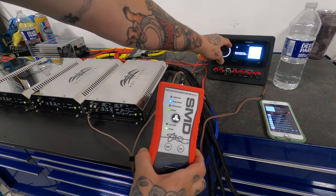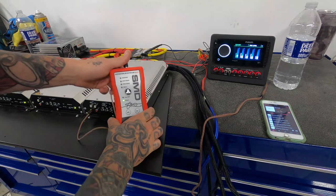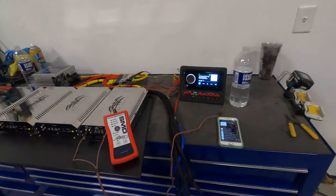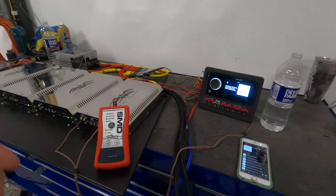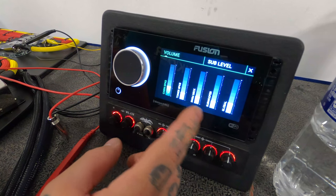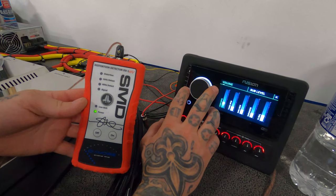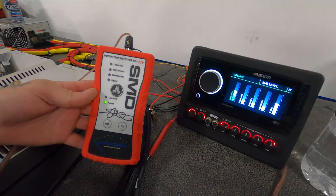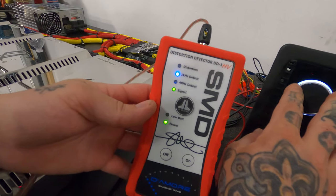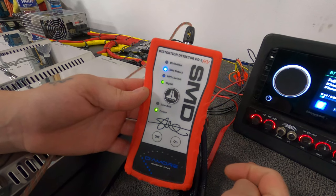This is going to be our input from the head unit. We're going to go to our cabin speaker volume. I want to show you the zone control on the radio — if we go in here, we have four-zone control and a global. So we're going to go one zone at a time setting gains. As we go up measuring zone one — which is our cabin speakers — we're going to see we get signal measuring 1K. At wide open, we have no distortion. Every one of these zones will typically measure the same on this radio, but we do go through and measure them independently.